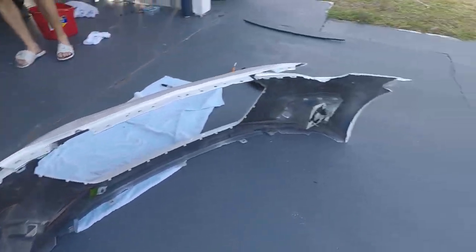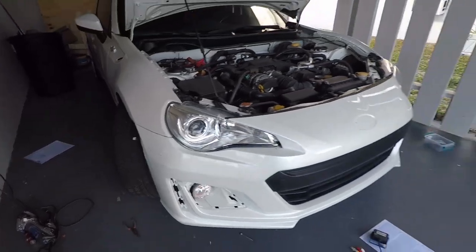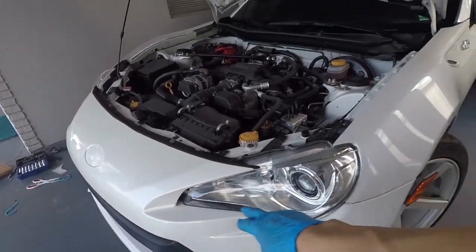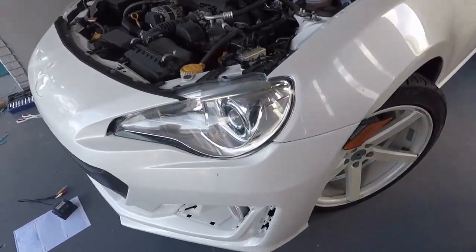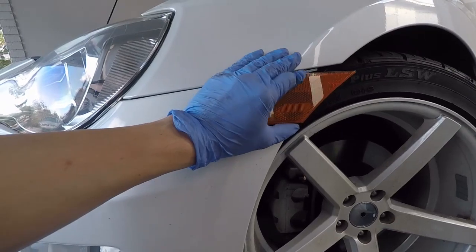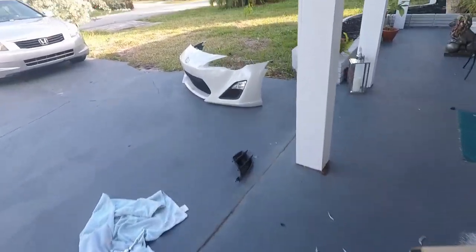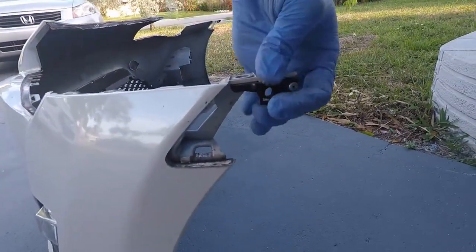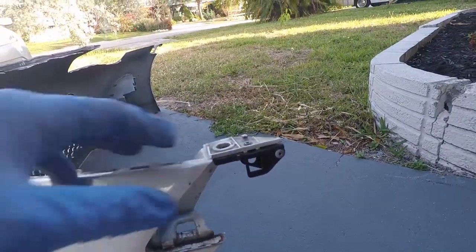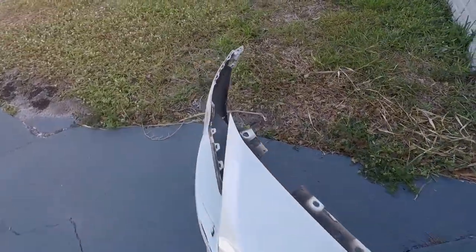Here's the BRZ bumper on the FRS. It was extremely difficult — you definitely needed two people. There's a spot right under the light that I never cut out, so I have to go back and do that. The sides also don't fit very well because I need the bumper clip for this particular bumper — the three clips on the side don't line up. Getting the light in is next to impossible. There's a piece on the original bumper that you need, so don't do this swap unless you buy that little black piece at the end first, otherwise you won't be able to attach the light. Everything else lined up just fine.